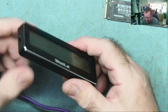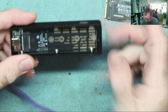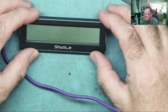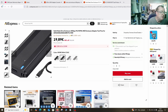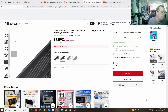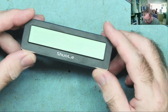This is something I can take with me at the car boot sale — probably just leave the cover off for that purpose and just plug these things in and try them. Let's look at the difference in price between this and a standard M2 NVMe to USB adapter, to see if we're paying a lot more for the screen. Prices will change with quality, but for metal case enclosures — 12 euros with some cables, 19 euros — so a similar price. Plastic ones are cheaper, but the metal ones conduct heat better if you actually use this as a drive.